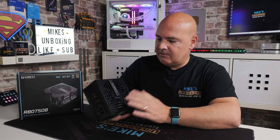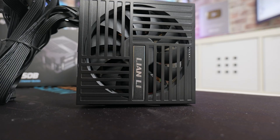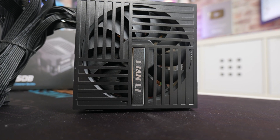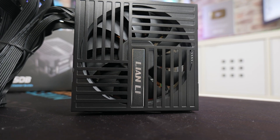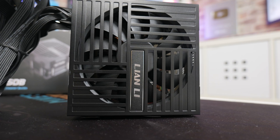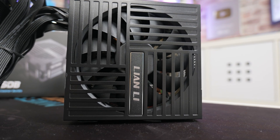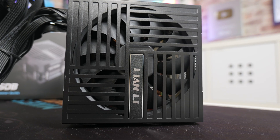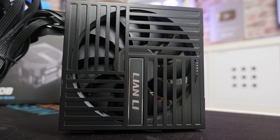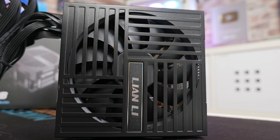The design is very sharp looking — really nice. They've done the fan grill in such a way that it actually reduces turbulence on the blades. The fan inside is 135mm, which is slightly unusual, but it's also got 11 blades, which generally will make it less choppy and give a nicer noise profile. We've done some testing today and it is actually pretty quiet. Let's have a little listen to the fan noise and you can see what it's like for yourselves.